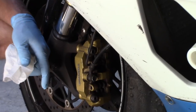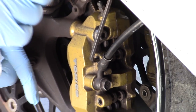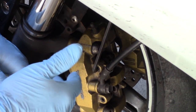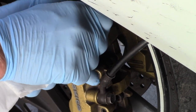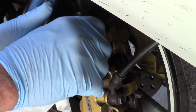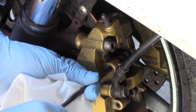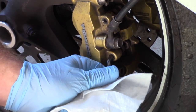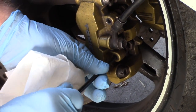Before you start this whole procedure, go ahead and loosen the brake pin. In this case it's a 5mm Allen that screws into the caliper itself. Sometimes you have little R-clips that you pull out and the pin slides out by itself — so there's a mechanism you have to be aware of. In this case we know they screw in, so we'll loosen these. Sometimes they may be very stiff because they've not moved in years.